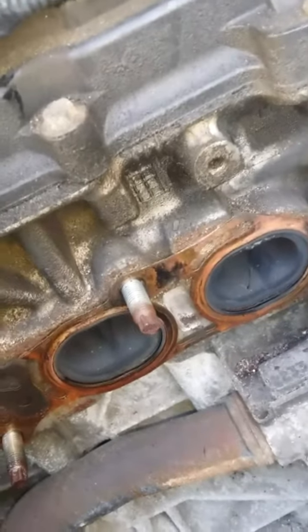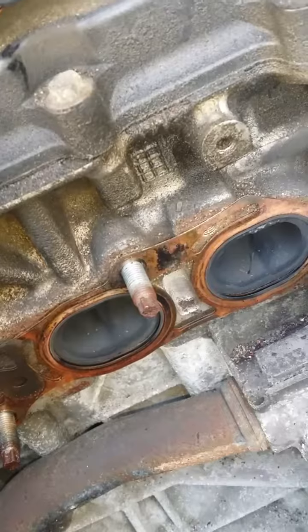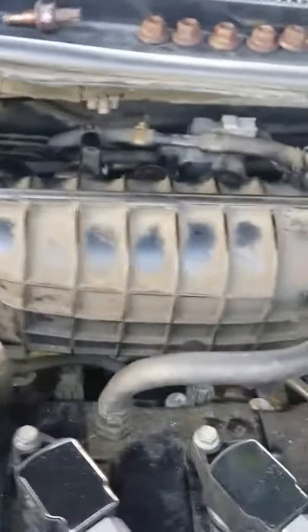If you have a P0300 code, if all else fails, make sure you've got no intake leaks, nothing like that, make sure of that stuff first. Make sure you don't have any air leaks, no faulty coils or faulty injectors, which Nissans are kind of known for. Injectors are back there on these.